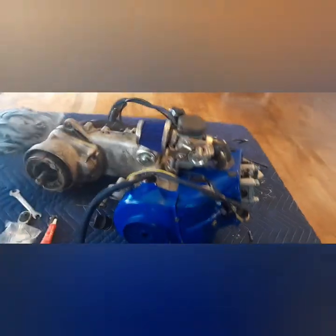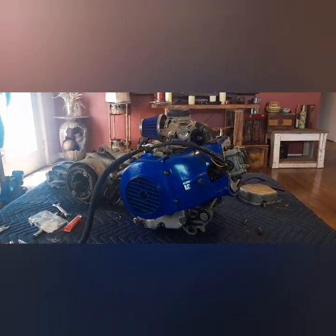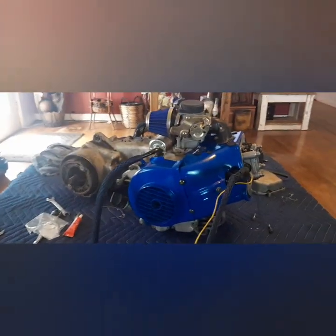let's get that carburetor on there. Just get these nuts tight. You don't need to be strong man on it. You're going to either break the stud or crack the riser or whatever. They just need to be tight. All right, carb is on. I'm liking this. It's no $10,000 Monster Racing super duper engine. I don't know what the hell I'm talking about. Just an inexpensive QMB, but it'll look better than it did before.